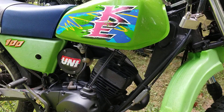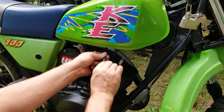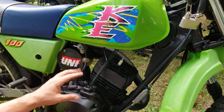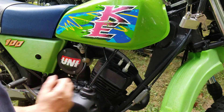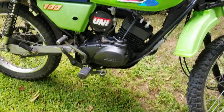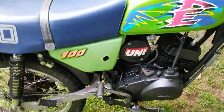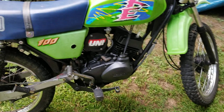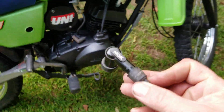Sometimes I forget things like this — I apologize. I've been getting a lot of great questions, a lot of people asking me about their bikes. I have the other style of this that I'll be using, so I won't be putting either one of these back on right now. The blue plug is coming out and I'm putting the black one back in with the resistor tip. Also, when you're checking your coils and you have a resistor tip on there, make sure you unscrew the resistor tip first or you're going to get a totally different reading.